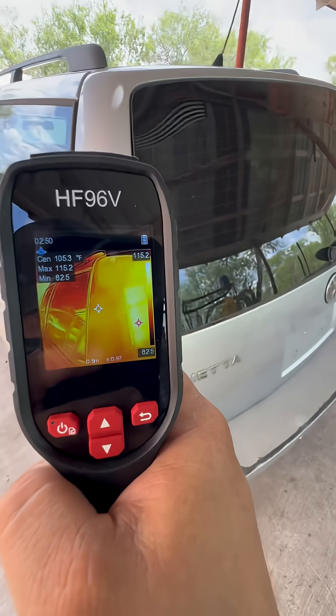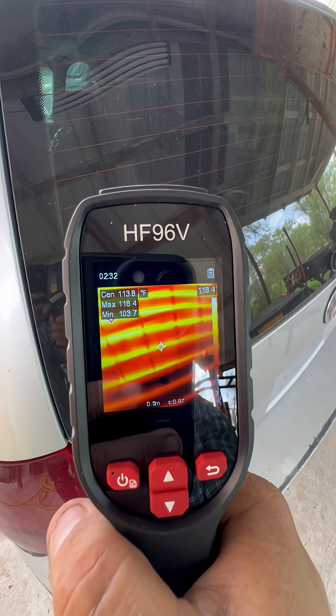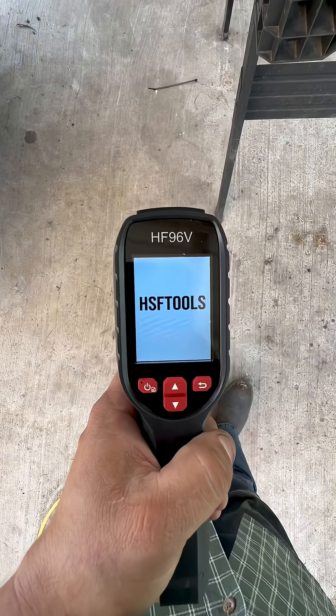All right, the amperage did go down. After waiting a few minutes, there we can see the defroster is off. Here's what it looked like before, and here's the after. So now I've got to figure out what's causing it to stay on — could be a relay, could be the component itself. That's for another video, stay tuned.